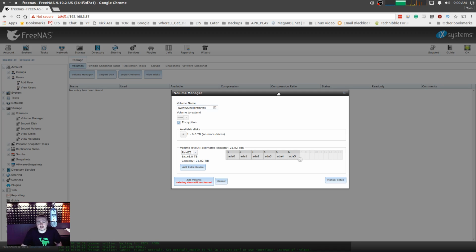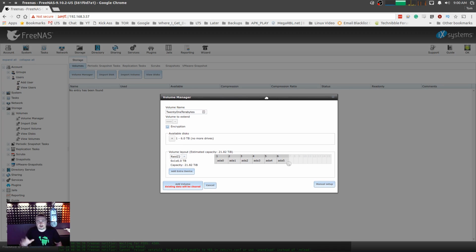And one of the real reasons you encrypt it, it's not just because you have personal stuff on there, but a lot of people do. It's if you send those drives back, where's the data going? Now, I know, granted, if one drive fails, they've only got enough data to maybe reassemble something, but it's not worth the risk. This way, if a drive fails and you send it back, there's no worry. The drive's encrypted, and without that key, they're not getting it. So I highly recommend encryption, but we're going to show you how to back it up.